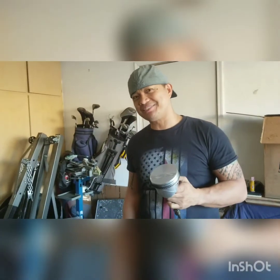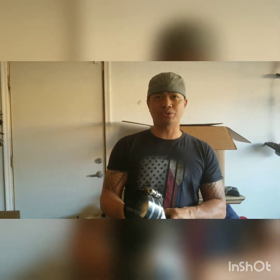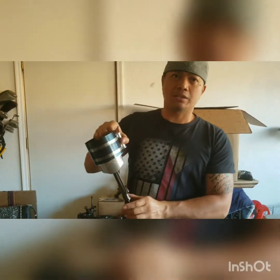I'm going to pop this guy in, then show you guys a video of what the rotating assembly looks like when the pistons are actually actuating. About to lay piston number 7 in — a little tutorial for you guys. I've never shown an assembly of a short block here. But this tool here is basically used to compress the actual piston rings themselves because they expand, and if you don't do that, it'll snap once you try to lay it into position.